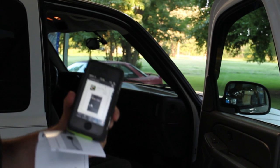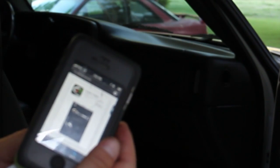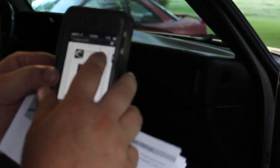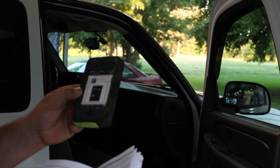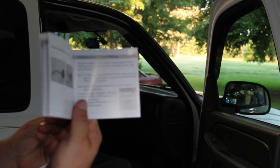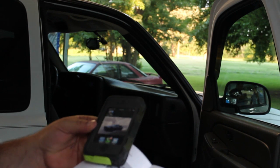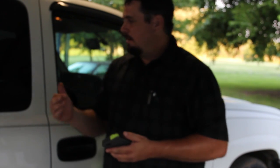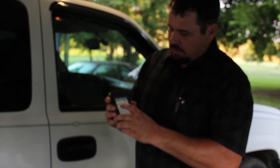Now I've got my iPhone — yes, I did break the screen on it. In this little booklet, they give you the app to go to. You type that in and it brings it up. It's a free app called PAPAGO Go Safe TPMS app. Don't make the mistake I made — I was searching for it in Bluetooth and couldn't find it, then realized the USB isn't powered unless the key is on. Turn your key on and it shows up with no problem. Once it's located in Bluetooth, you pair it up.